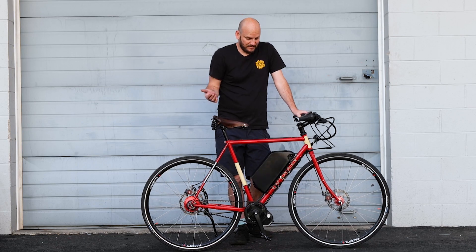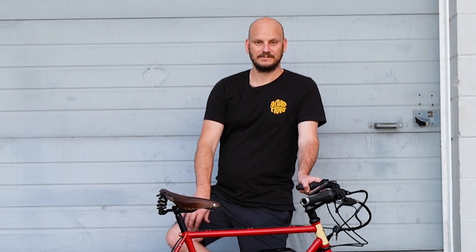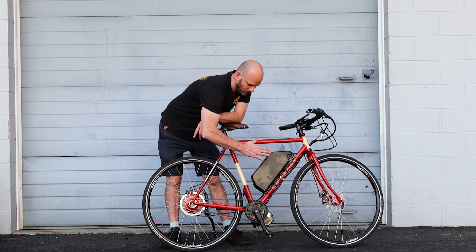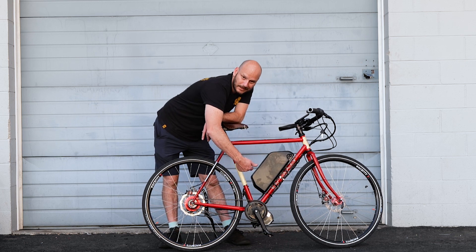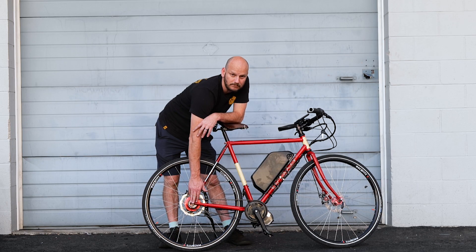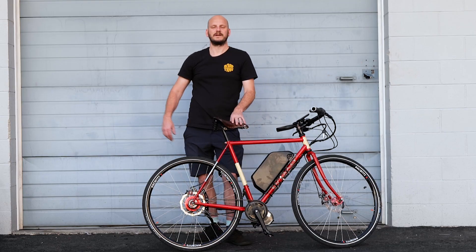You can see 35 miles an hour — definitely not bad. And this was on a half charge, so it was at like 53 volts. I'm sure if you charge it up to 58.8, you'd get another two or three miles per hour out of it. Just a really cool build. And if you are doing a belt drive, I would recommend going with the BBS-02 because the motor housing doesn't stick out super far, so your belt line is still going to be pretty good. Check the description below for a link to the belt chain ring adapter. I would recommend making sure you've got one with horizontal dropouts just to make your life easier — unless you've got a grinder, a lot of patience, a lot of guts, and you're not afraid to mess up a frame. Fortunately, we didn't even come close to that. Alright, thanks guys.